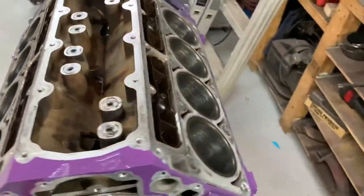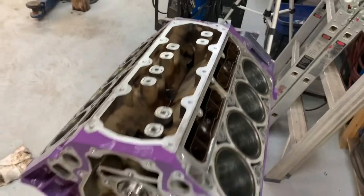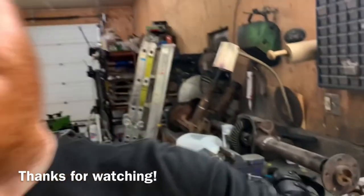And there we have it, boys and girls — lifter buckets are in. A little slight modification and we can roll on forward, ahead of schedule. I think that's enough excitement for me today. We got a lot done and I think in the next video I'll get the rods and pistons assembled, get the rings gapped, and put the whole rotating assembly together. After that I can decide which set of heads I'm going to use — whether it's the 862s and make like 10.7 to 1 compression, or use the 243s and make 9.6 to 1, which is safer in boost but not as much low-end power. Maybe you guys could give me some pointers — I'm on the fence, undecided, and it'd be nice to have a little push one way or the other. Thanks for watching everybody, have a good night.